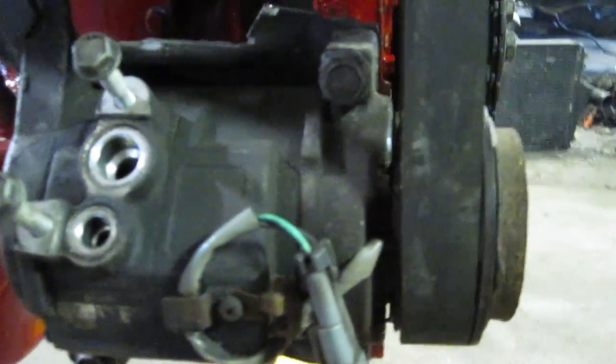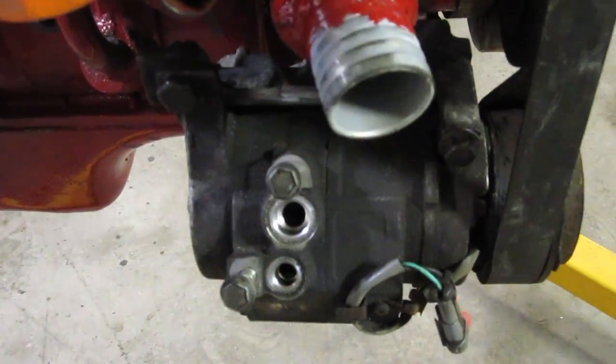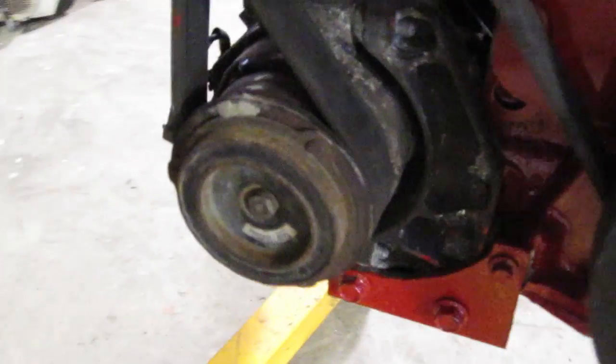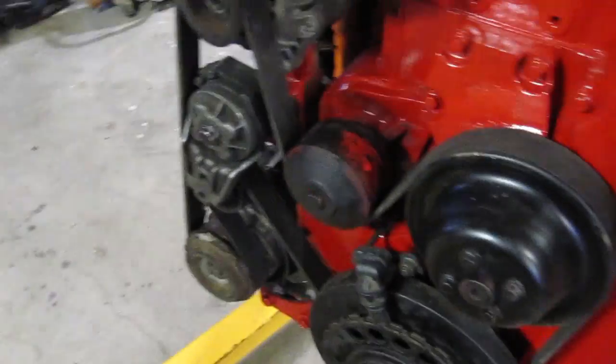You're going to want to use the AC compressor off of your GM so that the lines will work nice. By angling that lower rad hose you can avoid your AC lines. You want to custom make a pulley — you can take the ribs off of the 5.9 compressor and put them over top of the bearing and housing off of the lower, and that's still at the machine shop.